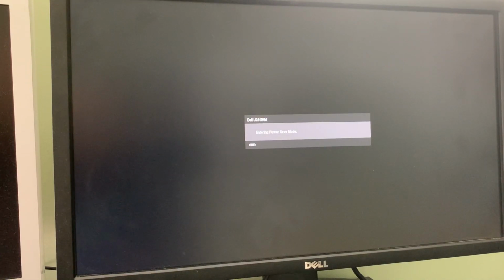Aha! Operation prohibited. Now, I believe this happened as well. So we're going to power it off, and power it back on. And I've got Command V held down, so hopefully we will get into verbose mode to get a better idea of what's happening. It takes a while to get to the chime on these machines.